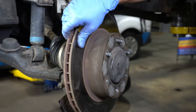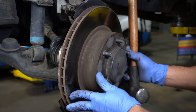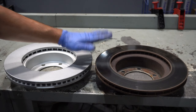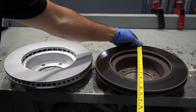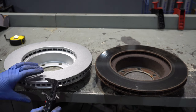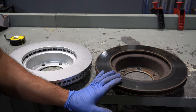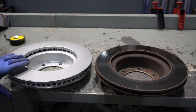My rotor here was actually loose already — I didn't have to do anything. Depending on where your vehicle is from and how old it is, it may be rusted along the edge. Since we're not saving this rotor anyway, you can hit it from behind to knock it off. With both rotors on the bench for comparison: the diameter is the same at 12 and a half inches, but the thickness is where we notice the difference. Measuring in millimeters: the used factory rotor is 21.64mm while the new Tundra upgrade rotor measures 28.08mm — definitely a very big difference.